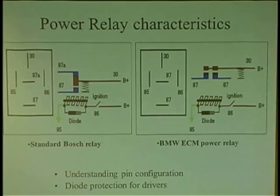And you ever see these? You ever see on a relay it says 87 87, doesn't say 87A? Like it'll have 85 and 86 here, and it has 87 and 87A, but this one has 87 87. Is there a difference? Look, this is double gang. So when you energize the relay, it's going to feed two things at once. So if you pull this type of relay out, and it's an 87 87, and you put a different relay in there, the car may not start.